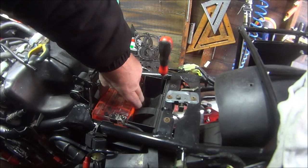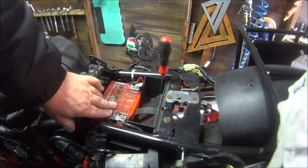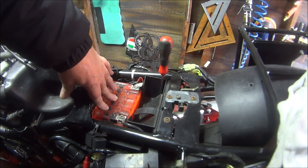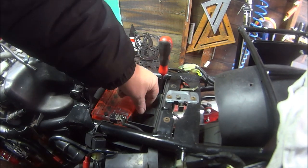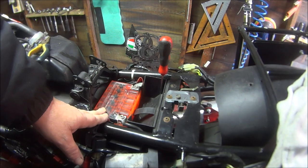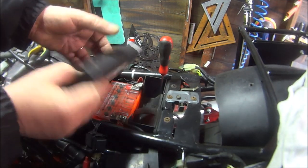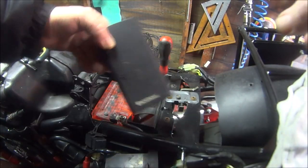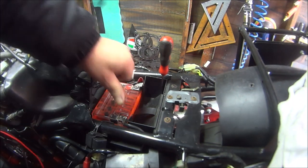I did also get a comment about the battery when I was charging it up. Somebody said it should not be charging at 16.5 volts or something, because it will fry the battery — it would even fry a car battery at that rate. Which got me pretty worried that I've fried my battery. Also on the previous videos you noticed the engine hasn't been spinning over briskly — that's because I haven't been using the battery. I've been using this power pack. All the video footage I've done, I've just used this power pack. I've just put the battery in this morning; I did have it on charge last night for 7 hours.